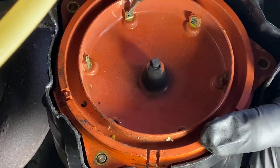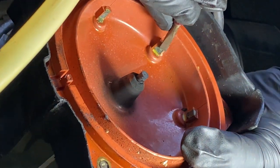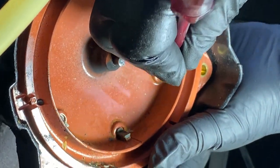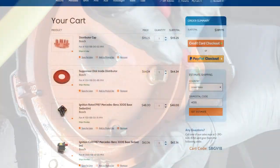No wonder this car was struggling — in fact it wasn't struggling, it was driving quite fine right up until the moment it gave up. The damaged coil, I suspect, could not overcome the resistance in the plugs and the resistance from these carbon buildups in the distributor cap. You can see the chunks of black carbon just flying off there.